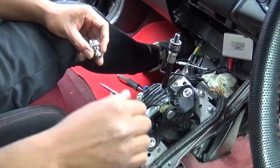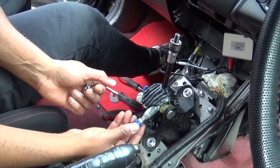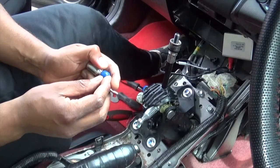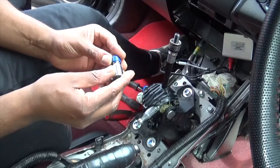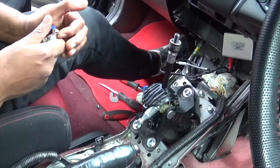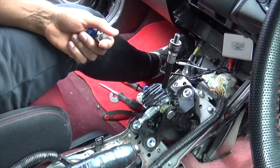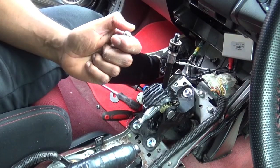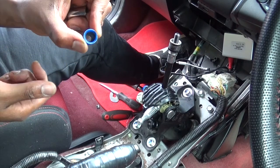Now what we're going to do is get to the main part of the short shifter install. We're going to replace the cap that was on here - this is now going to go onto this bit. You may find you have to use a vice to get that on and just clamp it - it should click on, but if you're feeling strong you might be able to just push it on. Also don't forget to grease it - get some WD-40 or something like that, just get some spray-on grease on the top there and also lube it in there as well.